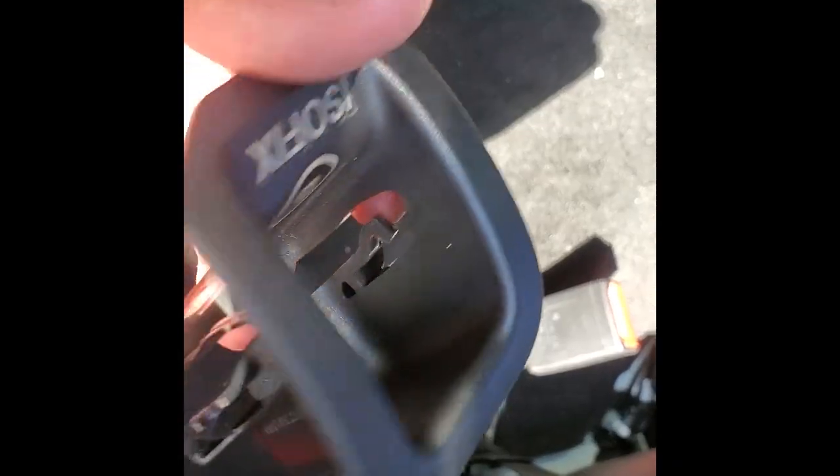I wanted to take my bottom seat cushion out. You've got these little things where the tie-down is — they have a little clip. You just got to get in there, lift with a little flathead screwdriver, pop one side, pop the other side, and they come right out and snap right back in. I did that so I could run this wire through here and up through a little factory hole. And while I was doing this, I also ran this phone cord that's going to be the bass knob, then started snapping this all back together.